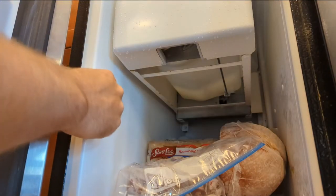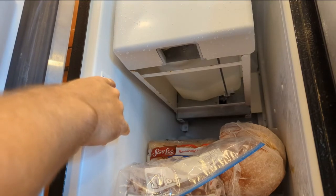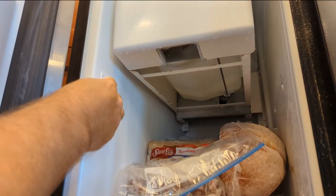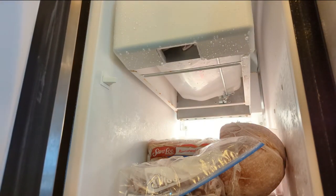You can see the mechanism in the back actuating that rod, and the trap door on the ice maker is opening properly every single time. How annoying. So I wonder if maybe something was frozen in position - just having it sit down on the counter and defrosting solved the problem.